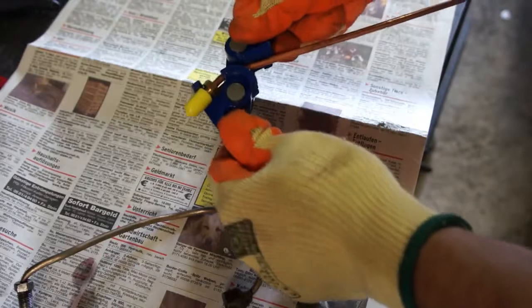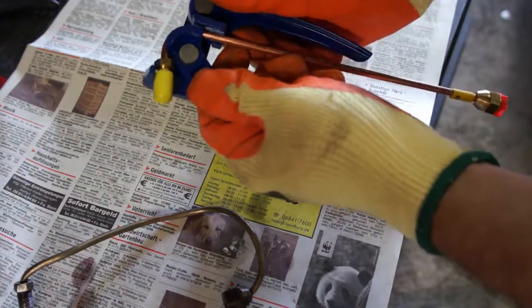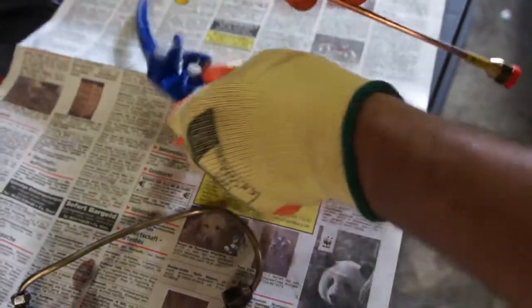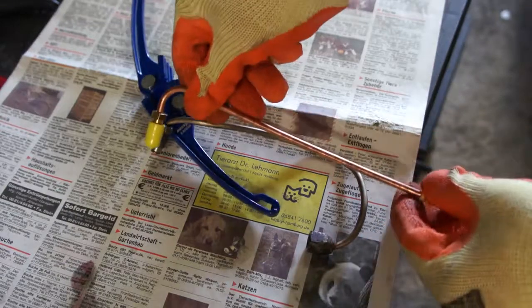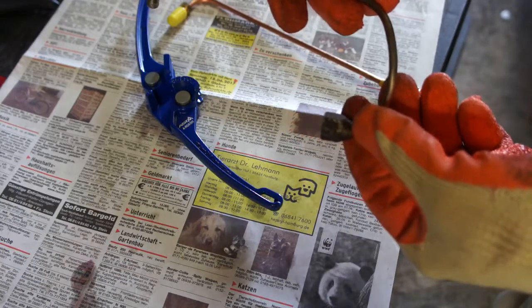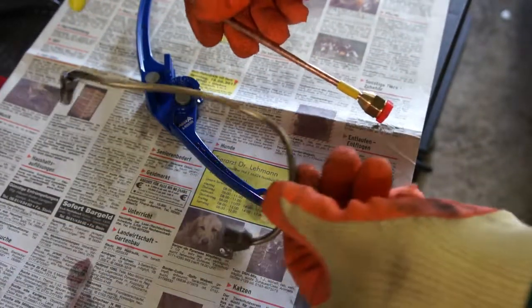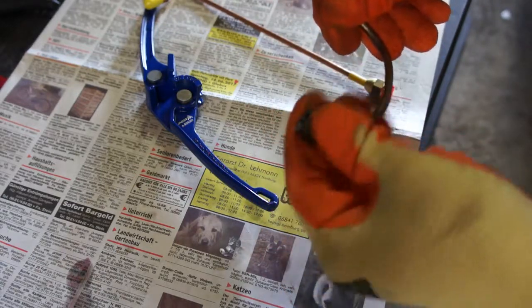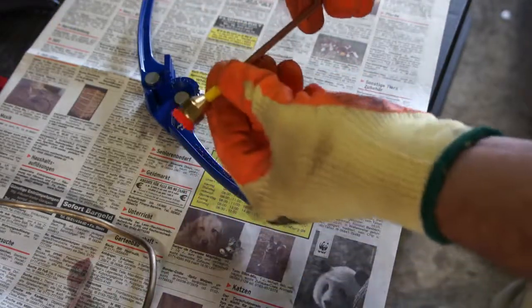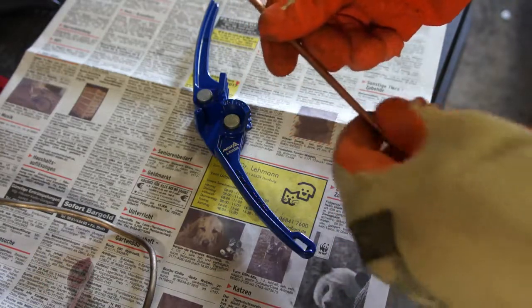So I'll start that right there - there's my 90-degree bend. Now you can see for the rest of this I'm going to need to loop it around and come back to connect, but I need to work in a different plane. I'll be coming out in a slightly different plane than the first bend - instead of coming straight up and then straight down, it comes out at an angle to meet the flexi hose here with this coupling. That's going to be basically a 180-degree bend, so I'm going to go over to the car and see how this is going to fit first.